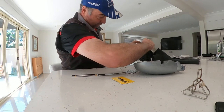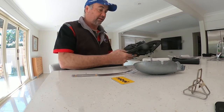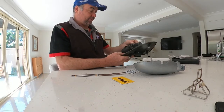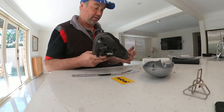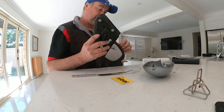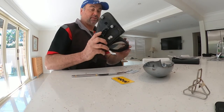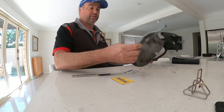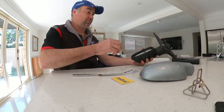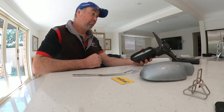Now here is your sensor, wired into this harness here. Although you can pull the sensor out, you can pluck it out — you've got all this wiring. There's one going to the electric motors, probably one running to the heater to keep the frost from building up, and one going to this little tiny sensor buried in the bottom there. So it's just a lot easier to extract it, clean it, swap this cover over. Next shot I'll be out there — shucking this on, plugging it in and see if we get the right temperature. If we don't, throw this one in the bin and wait for the next one.